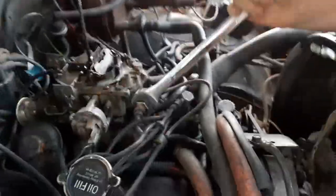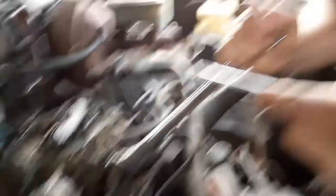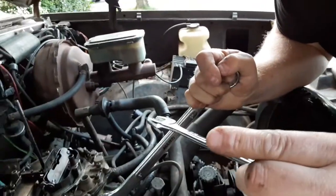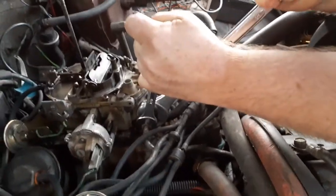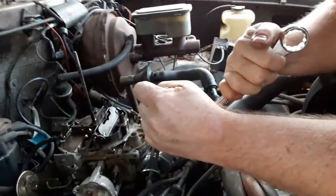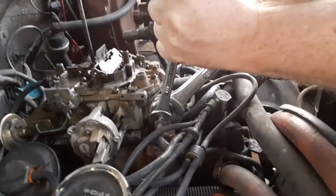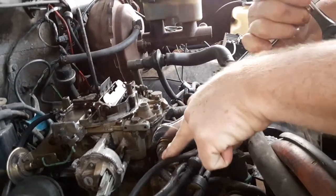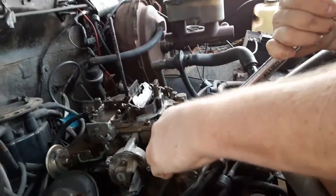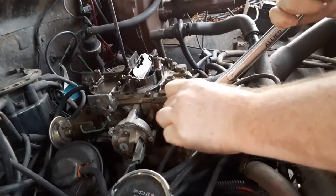You'll want a one-inch wrench — it's big — and it looks like a five-eighths. These are kind of hard to break loose. You'll want to hold the fitting back tight. Mine was snug — I pre-broke it loose already — because you can twist the fuel line very, very easily and ruin it. Ask me how I know. Yeah, and that'll make your day bad.